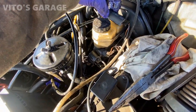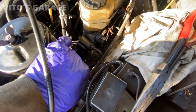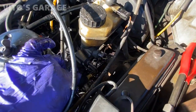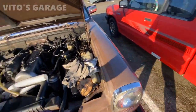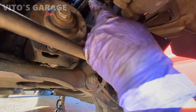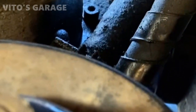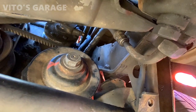Just a new hose getting ready to go on. There's going to be some fluid leaking out, so you've got to be fast. I lost some fluid but it's okay. I'm changing this power steering return line, and I had to disconnect the vacuum pump line right there because there's literally no space — mainly because of the horn. I have to get to this clamp but I can't really slide my hand in there. It was just in a horrible position. Whoever was messing with this didn't think of the future mechanic. But now I'm about to take it off, change it, and install the new one.